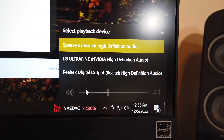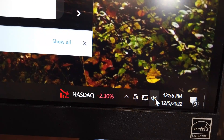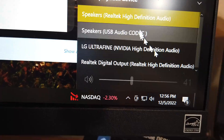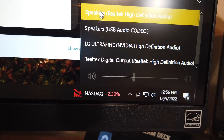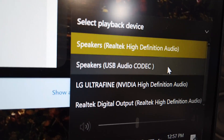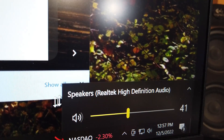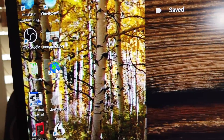So what's happening is: if you go down to your speaker icon and bring it up, there's a little up arrow — that shows your choice of sound sources. You want your normal speakers. You've got Speakers — USB Audio Codec listed there. If it automatically switches to that, switch it back to Realtek High Definition Audio.